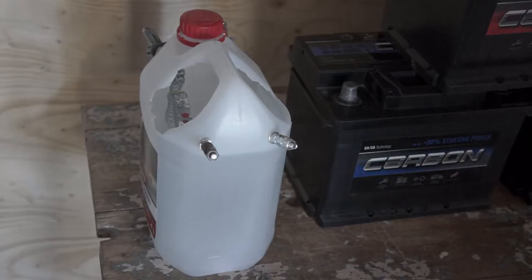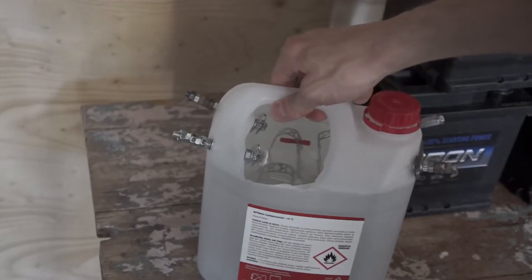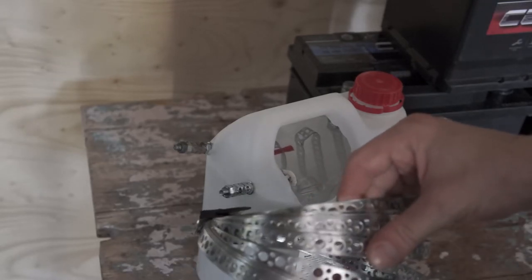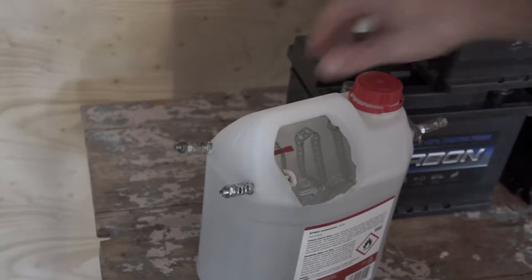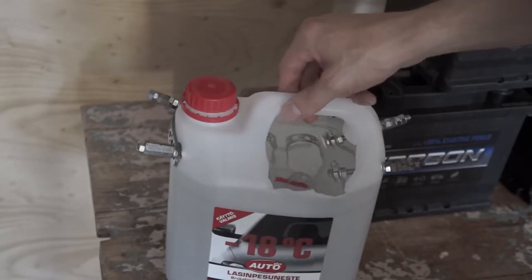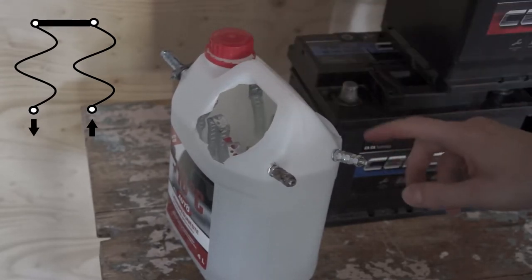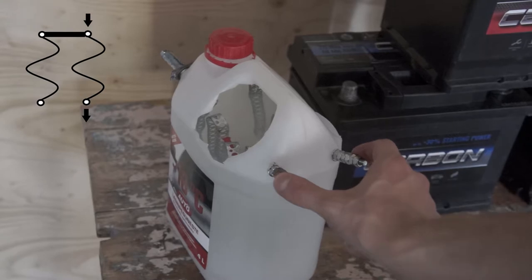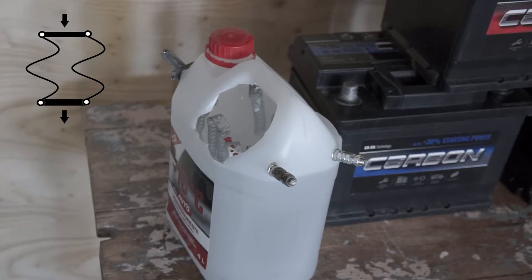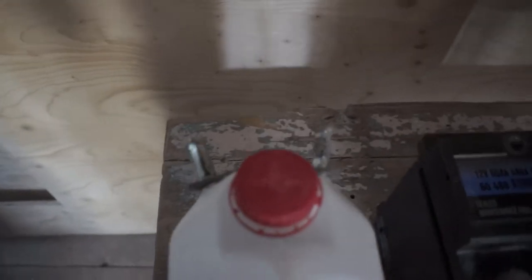How this battery dyno works is that we basically short the positive and negative battery terminals through this container with this kind of steel ribbon. Two 1 meter pieces folded and connected to the ends by bolts. There is a jumper connection at the end, and this allows us to change between three different loads. The easiest load to the battery is through both of these ribbons in series. Medium load through only one side, and the hardest, about 400 amps, in parallel connection. The whole thing is submerged in water to keep the ribbons cool.